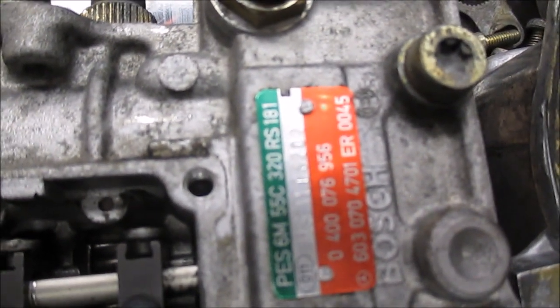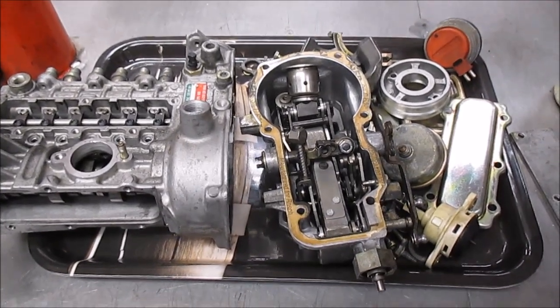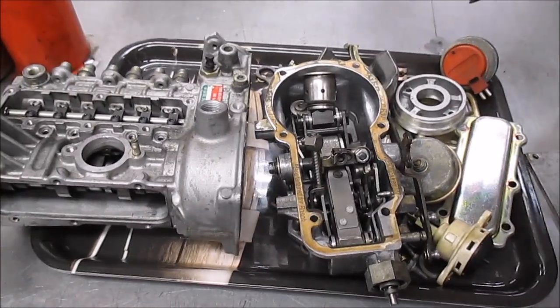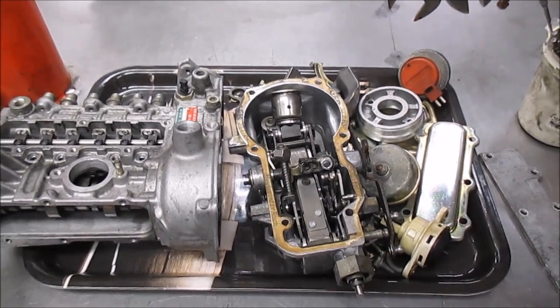See what's happening when we put a seven and a half millimeter pump like this one — this is the Shibiru. This pump is the OM606 turbo pump. We're going to put a seven and a half millimeter element in it and calibrate it as a naturally aspirated pump, then put it back and see what's happening. We don't necessarily need a seven and a half millimeter pump. Later on, that engine is going to be turbo converted, but it's going to be a very soft conversion. So we make the pump ready for boost.